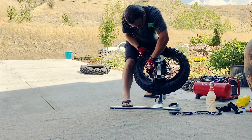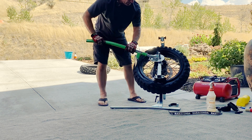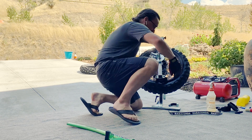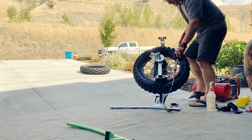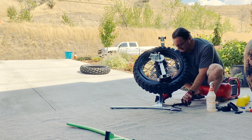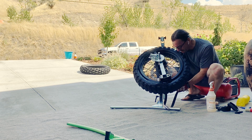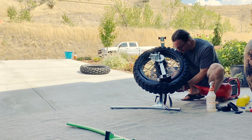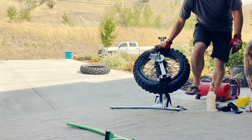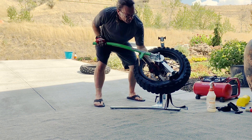Pretty easy. There's a little holder behind here to put the tire lever into. Now there's one more important thing we've got to do — you've got to use this little strap to keep things from sliding. Find a spoke to grab with this. This is what you've got to use on spoke wheels to keep the wheel from rotating while you take it off.